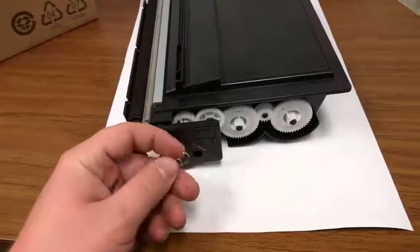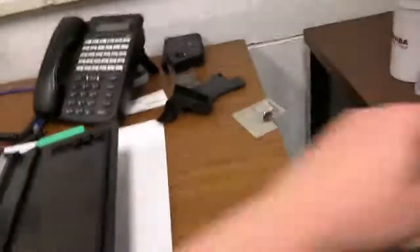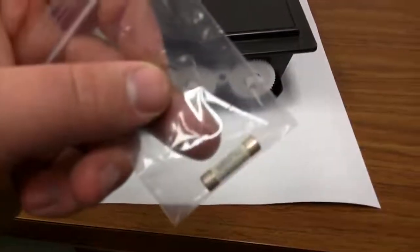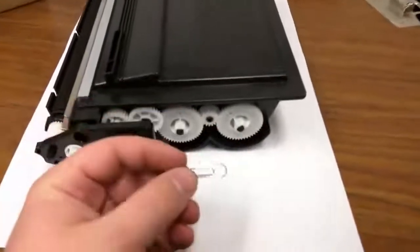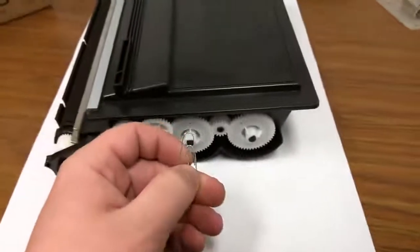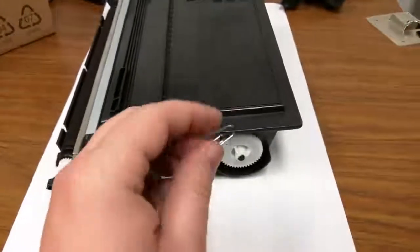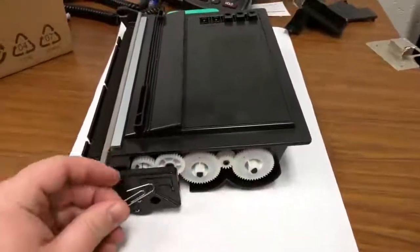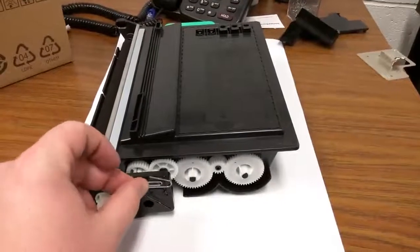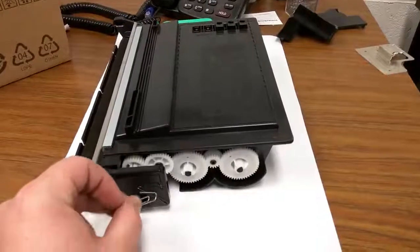What I did before I bought fuses — I went and bought fuses off DigiKey. They're just a little glass fuse, kind of look something like this, a little bit smaller. You can get something like that, but you can also use a paper clip. The only reason you can use this — be careful, do this at your own risk because there's electric current in the machine, but you should be safe. You want to suspend this between the two wires to bridge them, so when you plug it in it'll push into the machine and connect.